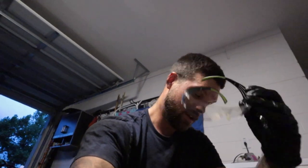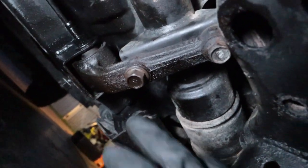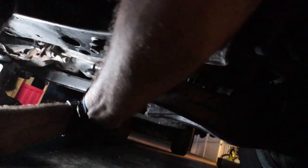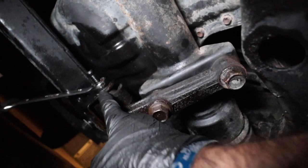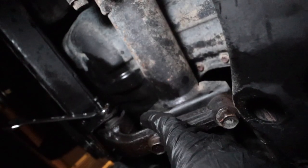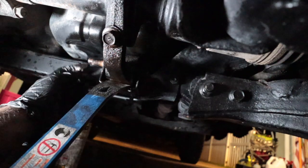Get the right tools, because that was horrible — however, just to show it can be done with basic household tools. It's going to take you a long time, but it can be done. All right, pushing forward — all four bolts here are 19mm, so you're going to need your extra wrench to hold one side. I was able to get these all broken loose. There actually is a nut behind each one of these, so I'm going to have to get the wrench back there to hold it in place while I remove the piece.